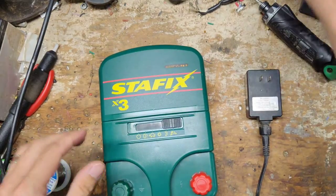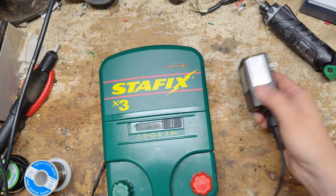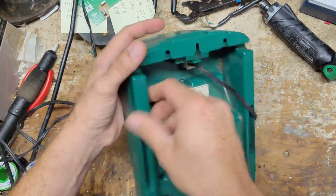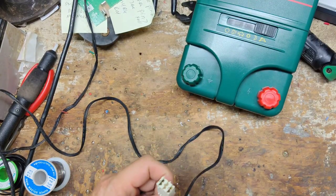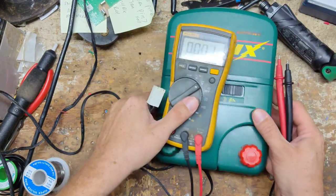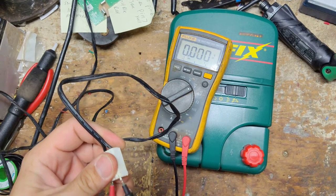The note on this one says it doesn't work — thinks it's the fuse. The customer sent the little AC adapter for it. I don't have a new board for this in stock right now, and it doesn't come on at all when plugged into the wall socket. Let's cut this little plug off the back and test this first. This is a 12-volt unit internally, so they take the little black adapter and convert it from 110-volt AC to about 13-volt DC.